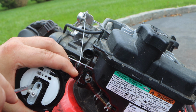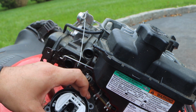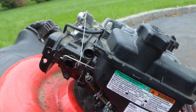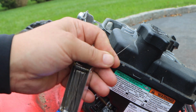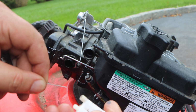Let's stick it in. Flat-blade screwdriver. Turn it up towards the sky, and it pops right out. Now, these jets you could order and replace. I'll drop a link to where you guys can buy them if you don't feel like cleaning out the carburetor, or cleaning it is unsuccessful. You have holes 1, 2, 3, and 4. This is a tip cleaner set. Links to buy this will be in the description as well. And now we're going to stick them in each and every hole.